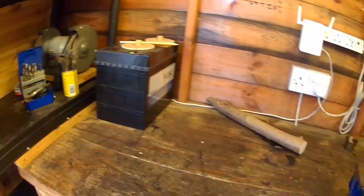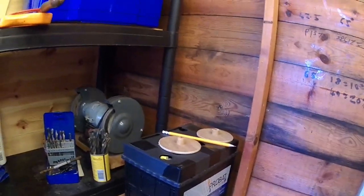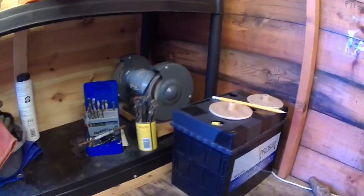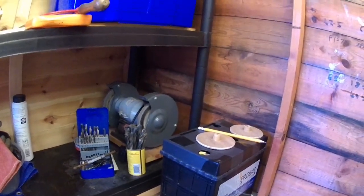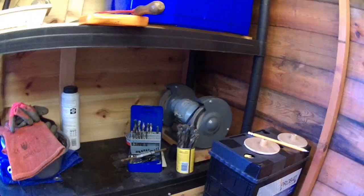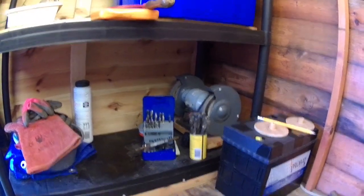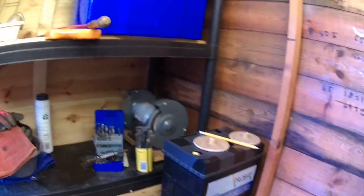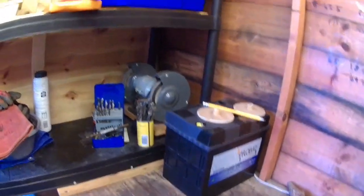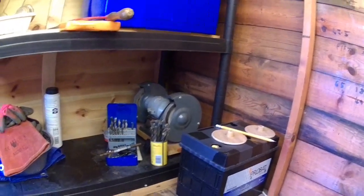The issues I've had with the heaters are silly things. The quality of the clips that go around the exhaust, for example the Jubilee clips, they corrode very badly, especially underneath the van. I've replaced them twice now, and it's not a big issue, but if you buy decent ones I think it saves you problems in the future. I think the plating on them is very poor, or it's the fact that they get hot and cold, with the heater on then off, and the salt from the road gets on the exhaust. That's the only criticism related to the exhaust.